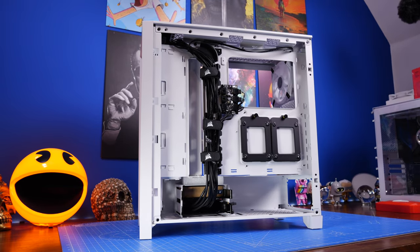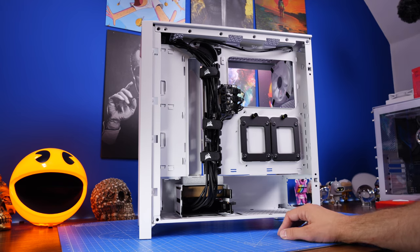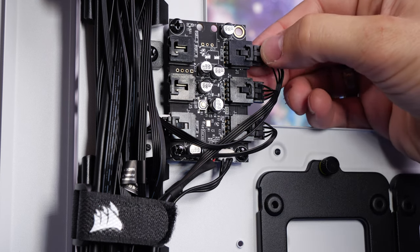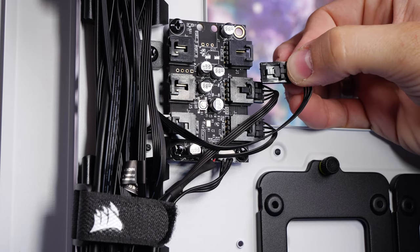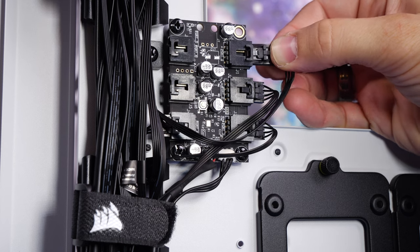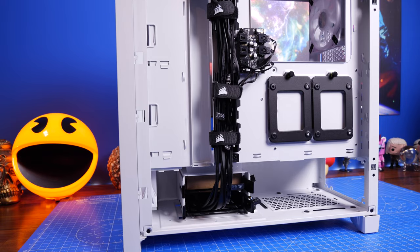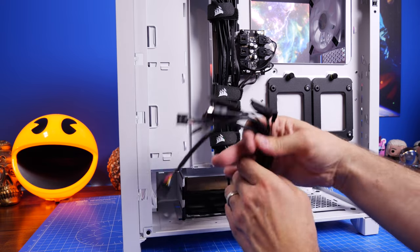Getting the rear panel off gives you access to the back. One of the highlights of this case is the design of the cable channeling and management at the rear, and there's also plenty of space. I'll leave all the specs of the case and build in the description. One interesting thing immediately is there's an RGB node at the rear with spots for six fans, so you can connect the RGB side of the fans into this control hub, then connect USB and SATA power to it. You then have the RGB lighting set up, but not the fan power — and I'll talk more about that as we go through.